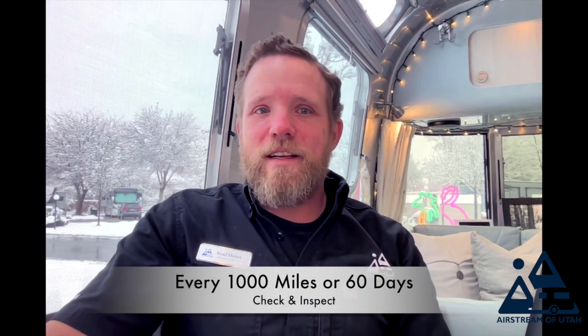I come to you today sitting in my own rig, and I want to talk to you about maintenance. What Airstream recommends basically for every single travel trailer that they have. Every 1,000 miles or 60 days you should check a few things: your escape window, your battery, your smoke alarm and CO detector, your tires, your hitch, and your GFI circuit breaker.